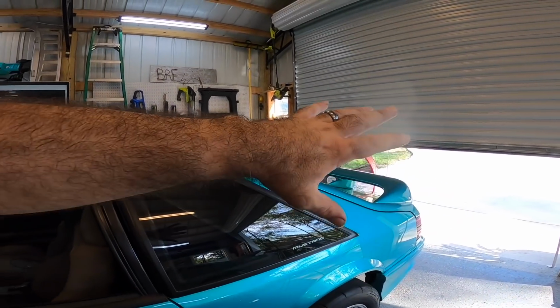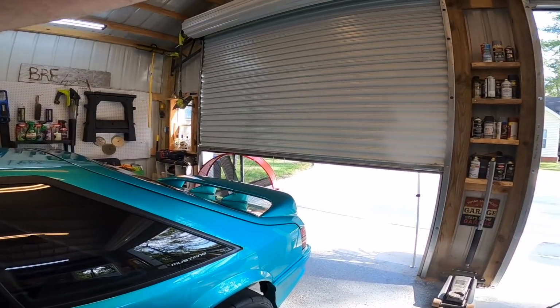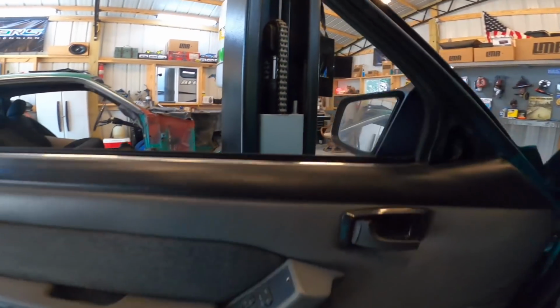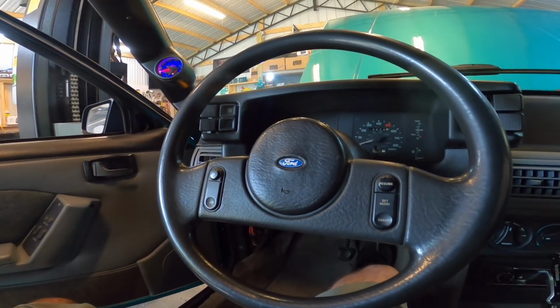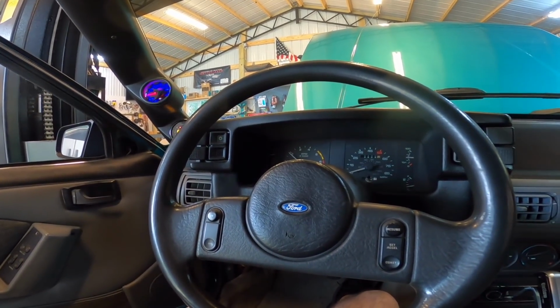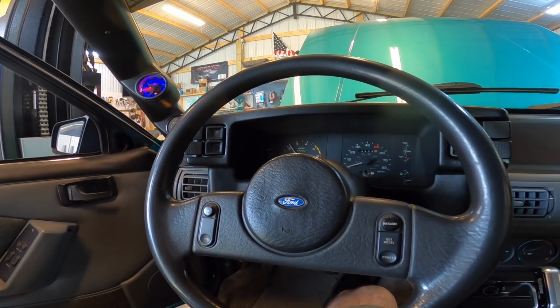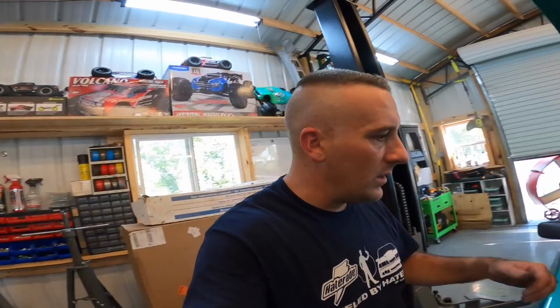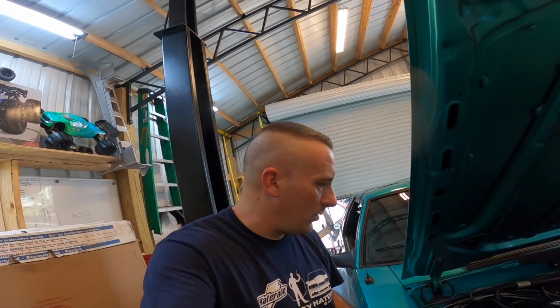The car is so deep, every time I start it up and the door's up there, it wants to fall. Crazy. So that TPS is not reading right. I want to go ahead and take that one off, since that was an old one, and toss this other one back on and see if I can figure out what's going on here.